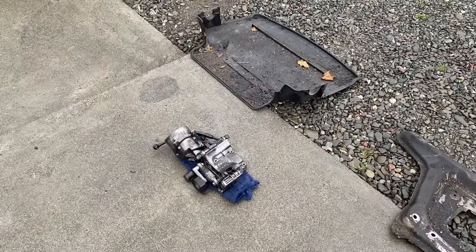With the new O-ring going in, got to hit it with some Silglide. Get some heavy, thicker lubricant on that O-ring for that first initial saturation, then fog it with some lighter wet silicone. This one's got a metal impeller too, so it's a bit of an upgrade. That should just pop in effortlessly. I'm happy with that. Slap our nuts on — water pump's torqued up.